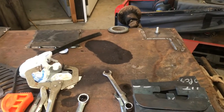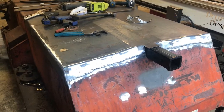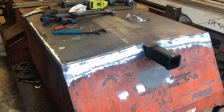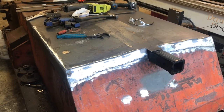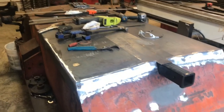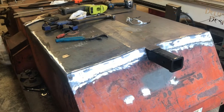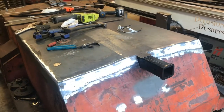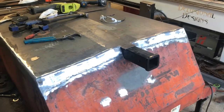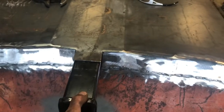The rear's about done, getting really close. After a couple hours of work we've got a lot more progress on this thing. Basically got the rear end pretty much buttoned up. I could probably flip it over now except for the work I've got to do on the front section. Got the whole back end welded in down tight, ended up having to do little cuts along here, heating them up and bending them over. Got the receiver hitch — it's just sitting in place there, I don't know where to set that yet.